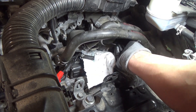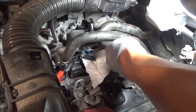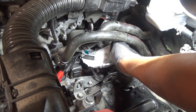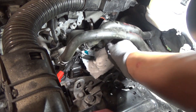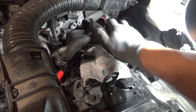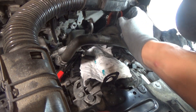The bolts all have a pretty long shank so they shouldn't just fall out on you. I'll try to grab them all out with a magnet. Now we should just be able to pull the whole throttle body out. There is an O-ring or gasket on the back, so be wary of that — the orange-red O-ring stayed in the bore, so hopefully you can see it in there. That's supposed to be replaced.